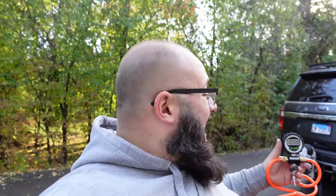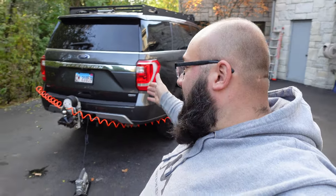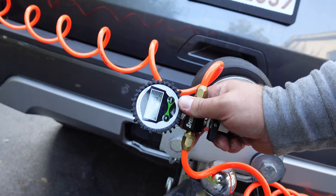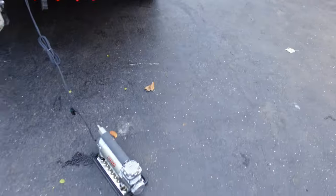If I were to equalize the tires and wanted equal pressure — let's say one was at 65 and one was at 52 — I could put them together and simply switch this flap and it would equalize the tire pressure. That tire was actually at 55 psi and that one was at 41, so they are equalizing. As you can see they are equalizing right now — it seems to be at 48. If you wanted to let air out you would simply open this and now it's deflating from both tires. Let's hook it up to the compressor and fill up the tires.